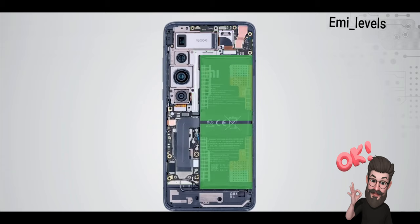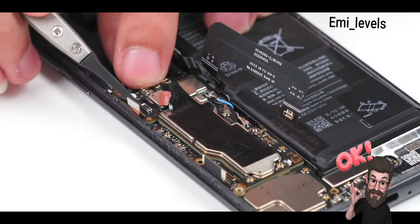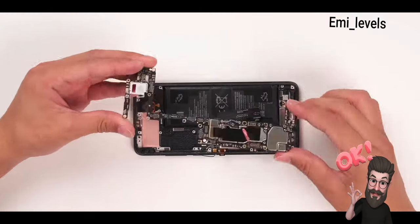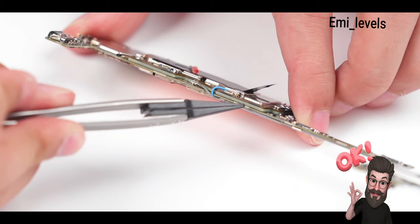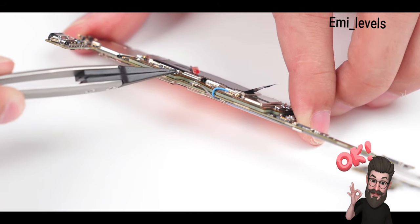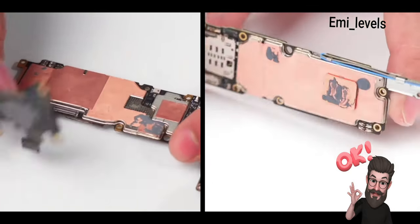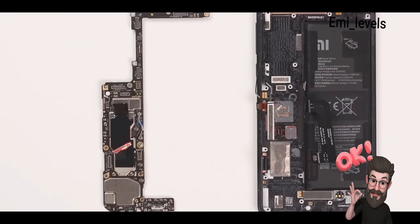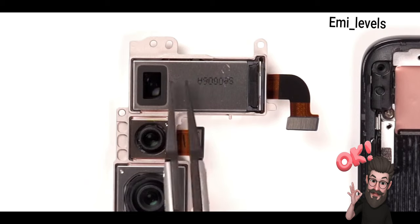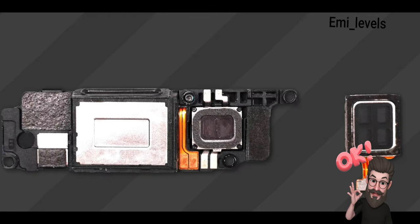On this side we have two batteries. Disconnect the display connector, fingerprint connector, and the top antennas, then remove the motherboard. The most obvious difference between the regular Xiaomi 10 and Mi 10 Ultra is the double-layer motherboard on the Ultra, using the welding and stacking method, whereas the regular model uses a cable connection. The top design is also completely different to accommodate the huge 120x zoom lens.